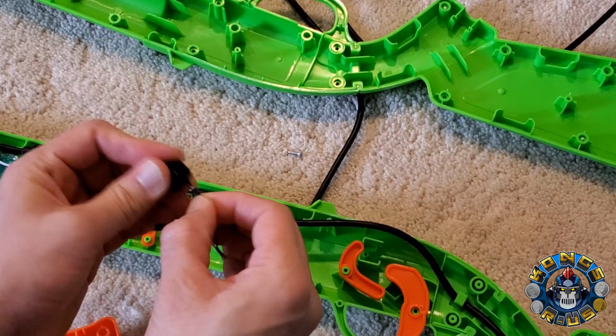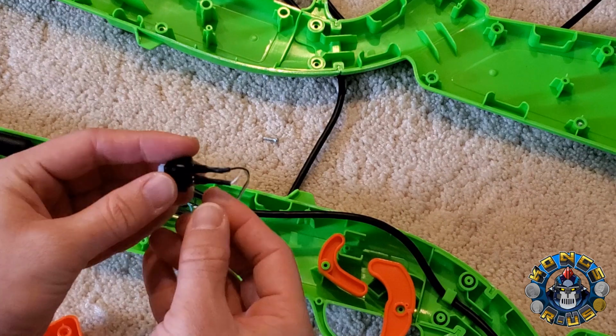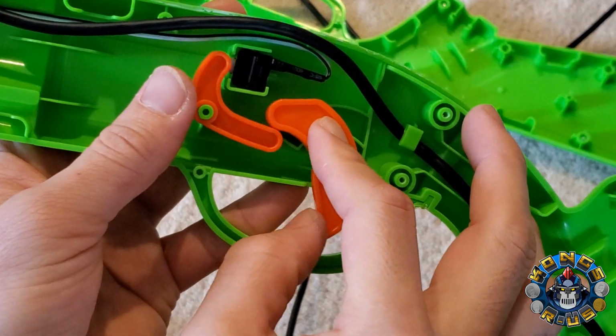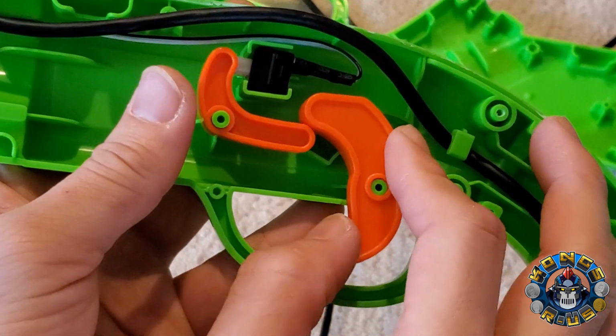Next, reattach the same wires to the clicking micro switch and replace exactly in the same place you pulled out. It shouldn't matter which way you replace the wires, but try to keep the same orientation as the stock switch. Now make sure your trigger is working properly, and then listen to that sweet clicking sound.